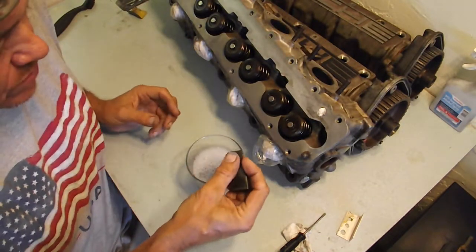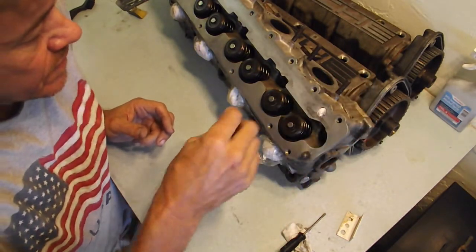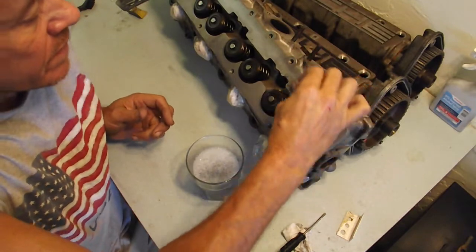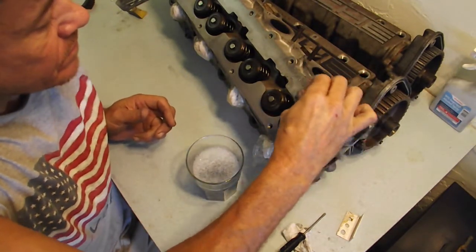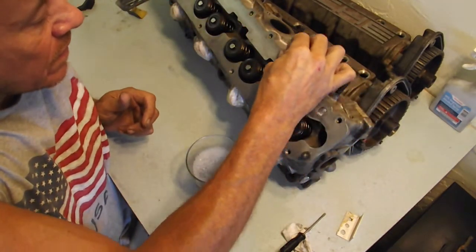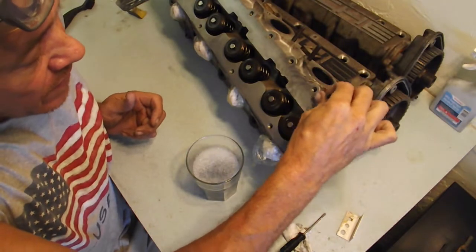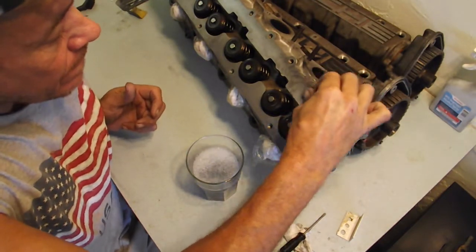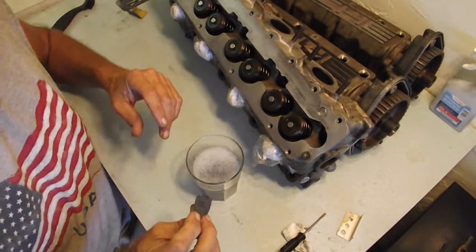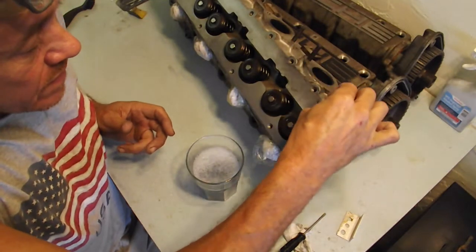So then what you do is, when it starts getting clogged up, you'll get this almost frothy feeling. Where when you're doing a spot for the first time, see how that frothed up? That's the metal mixing with the soap and creating almost a cushion for the sanding abrasive. You don't want to use too much because I don't want this dripping down.